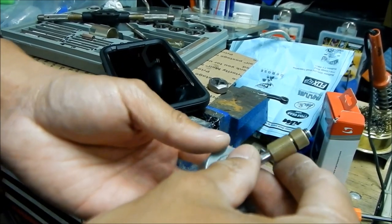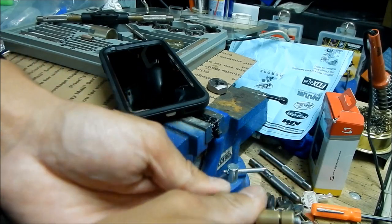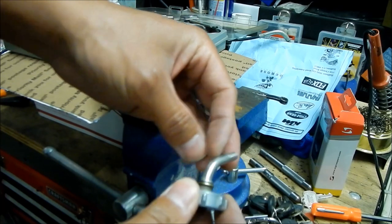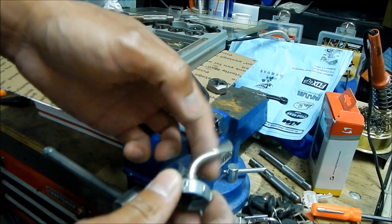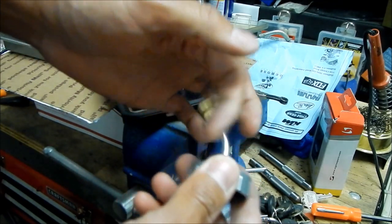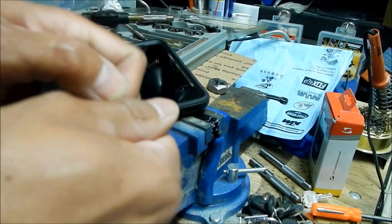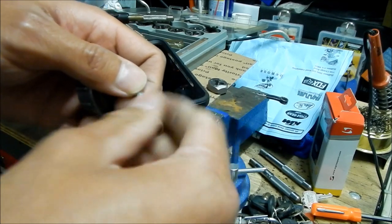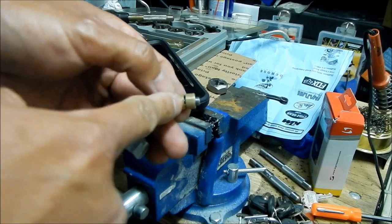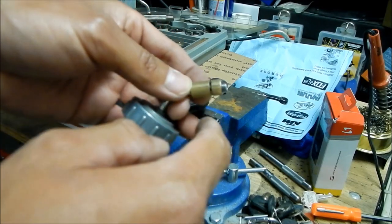What I think I might do is just keep this loose so we can swivel it a little bit — that way we can point it any way we want, because the stock one does the same thing. This doesn't seal anything, there's no reason to seal this. This one swivels like that too so we're just gonna leave it loose to swivel any way it wants — that way it'll be easier to get the cap on. The next step is to shorten this so the cable will go into it and we can still put the little clip in there. That means we gotta cut it right around here.